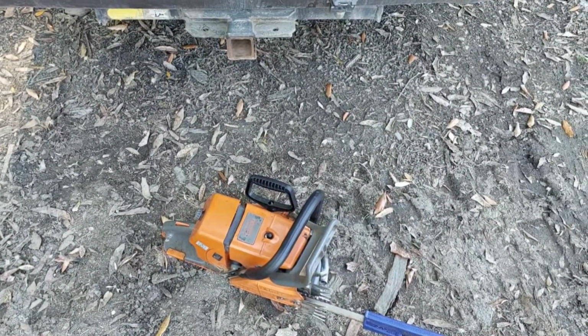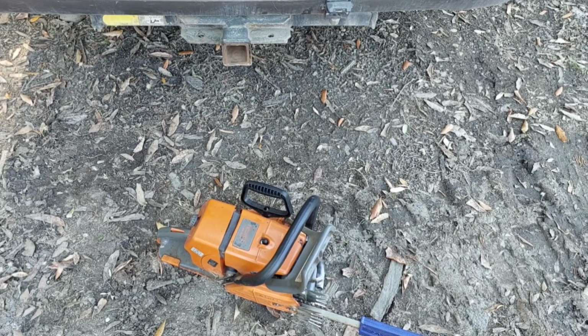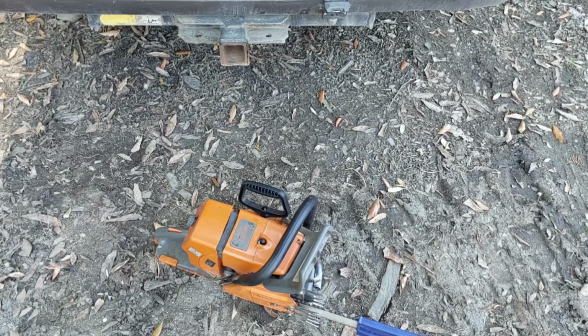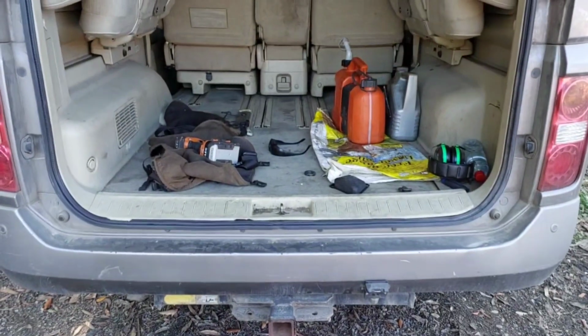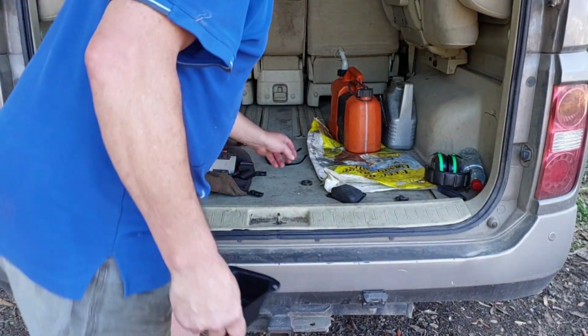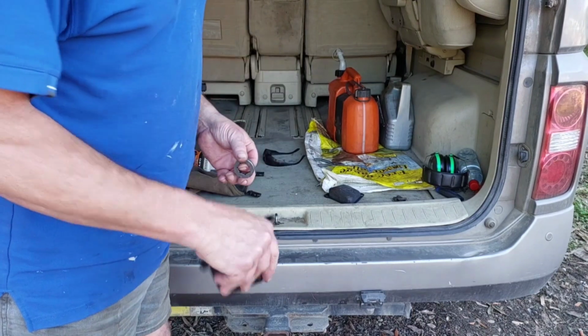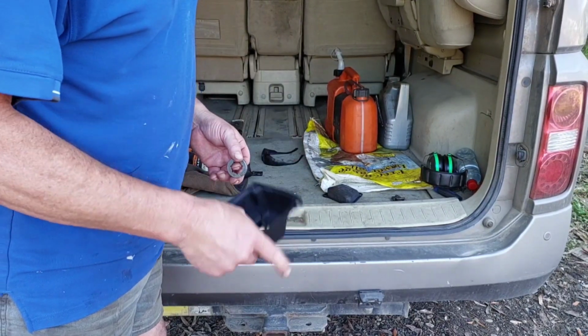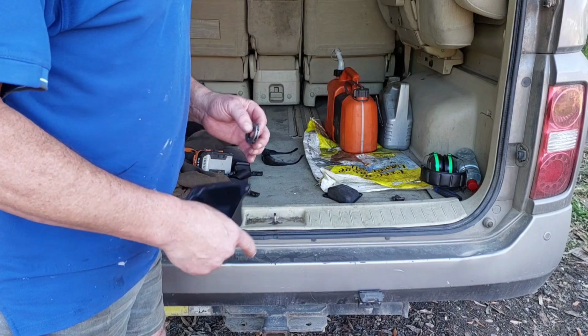Now, at the moment, that's all there's running, an 8-2-4-4 chain. When I'm finished, I'll get the best muffler and all that. I'll then switch it over to a 7-2-4-4, which I've got here, and see how it performs. But I really think this thing needs a timing advance with this big cylinder. It just doesn't have the high rev that I expect. It's good, but it's not good.